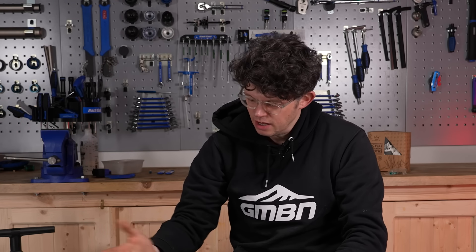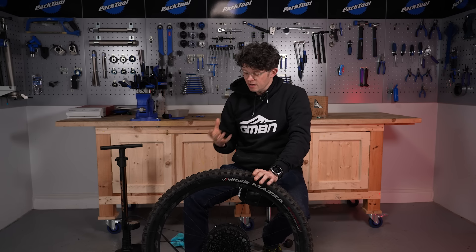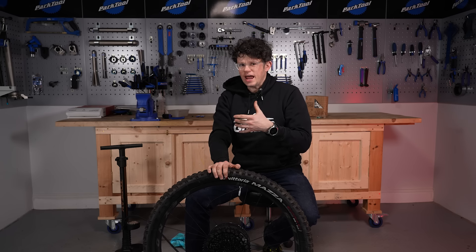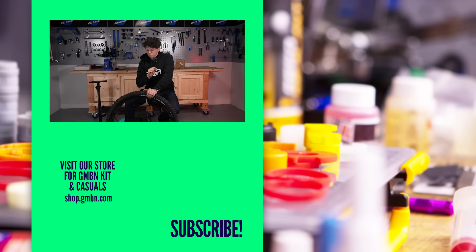That's the insert inserted — it really is that simple. There's a bit of tire sealant on your hands, but it's a really smooth process. You can save not only a tire but a rim, even a whole wheelset with one of these. The downhill version here is only 185 grams — super light. Be mindful though: even though these are low volume and low profile, they will change the tire volume. The pressure still reads the same on your gauge, so if you're used to running 27 or 28 PSI in the rear you still can, but the air volume you have to play with is smaller. Use a digital gauge for accuracy, because the margin of error is reduced — the difference between 26 and 28 PSI will feel much bigger with an insert inside. Insert inserted — time to go ride.